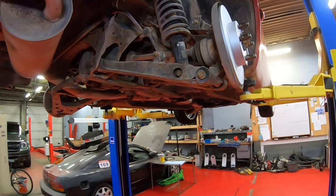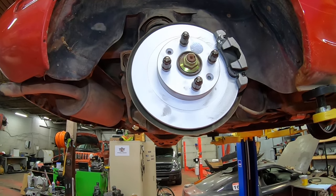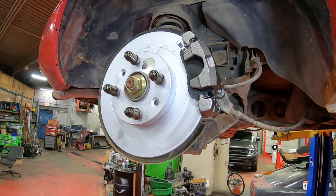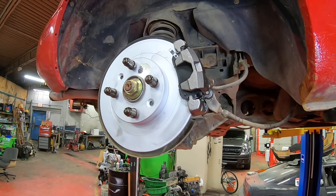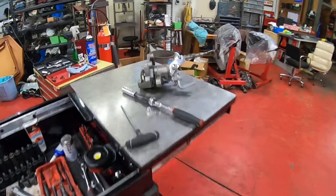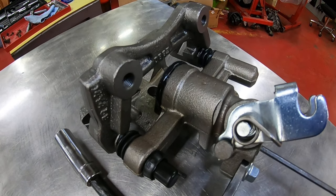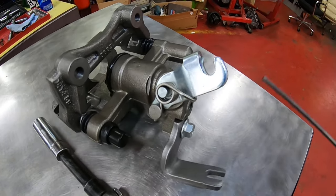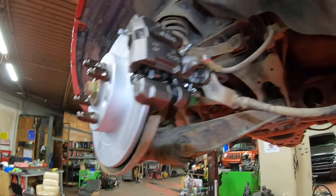Nothing more to it — just put the cap on the back. But if you followed these steps and your parking brake doesn't work, it almost always means you need a new caliper. The other unfortunate piece is we've tried every different brand of remanufactured calipers and about one in three show up dead on arrival — brand new part, doesn't work. So I always test them here on the bench first, spin it back and forth, make sure the piston will compress and retract, before putting it on the shelf. You cannot trust that a brand new one in the box is going to be good.